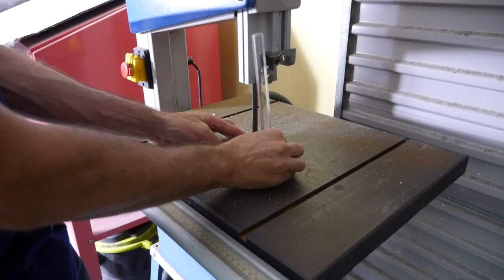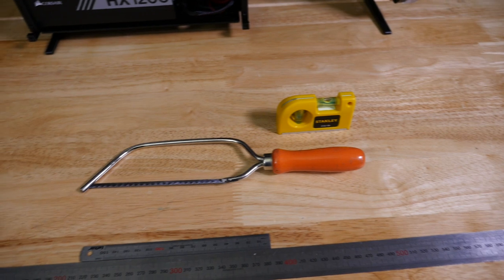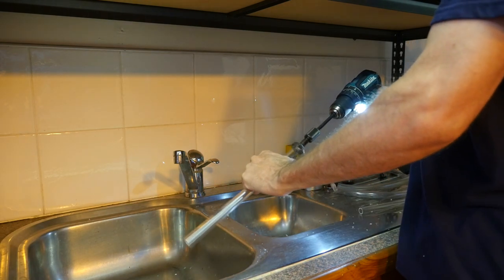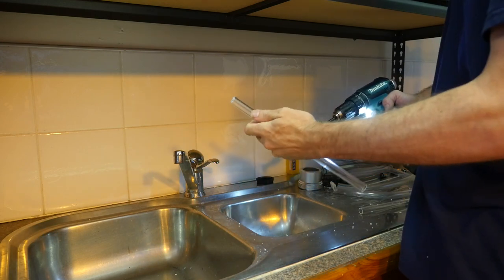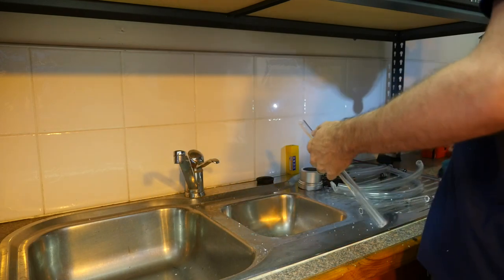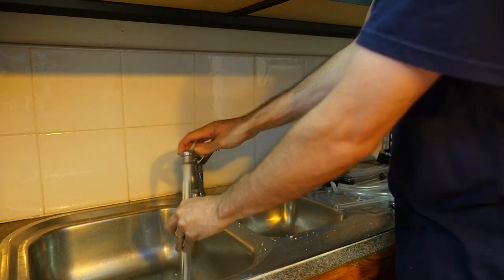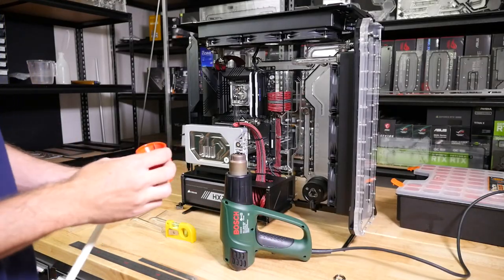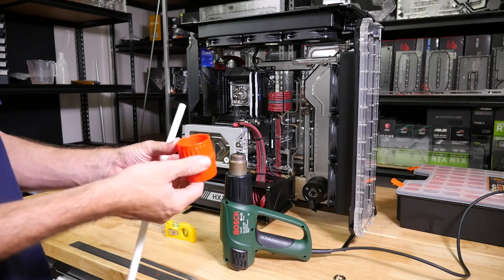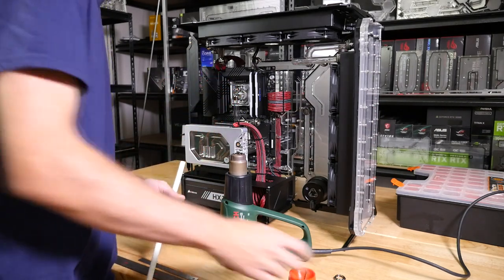For cutting, I'm using a bandsaw because I have one close by — it's quick and easy — but you can just use any kind of hacksaw or the saws and cutting tools that come with the tube bending kits. After I cut, I chamfer, and I have a nice chamfering tool for the drill. Then I like to wash the tube out with water because it gets out all those tiny filings and particles you may not get out by just blowing the tube. You don't want to be blowing into the tubes anyway, because the bacteria from your mouth gets into the tube. The reason I don't use the chamfering tools that come with the tube bending kits is because they go blunt really quickly — they're only good for about two systems.